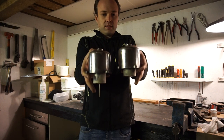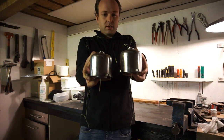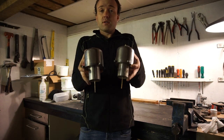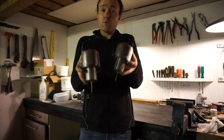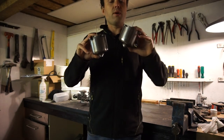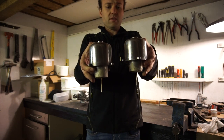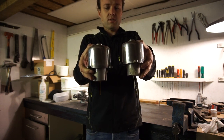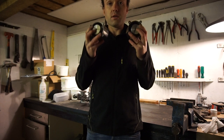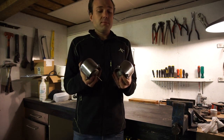Alright, this one was a little faster — this one is a little bit faster but they were very close. I'm going to swap them over and see if it's worse or better. Okay it's all swapped over — let's try again. That was very even. Very, very even. This is definitely the way these pistons and dashpots are supposed to go together.